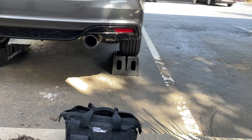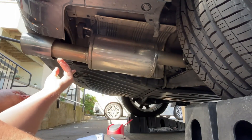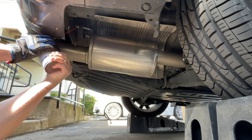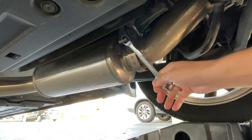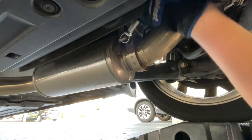I was off by a little bit, not bad. The toughest part of these exhaust installs is always these rubber hangers — everything else is pretty easy, just unbolt and hold stuff up. So the first thing we need to do is unscrew that right there. This is just one pipe held in by this hanger — here's the resonator and the mid pipe — and this is going to be a 13 millimeter. Thank you very much for the ratcheting wrenches, these are amazing.